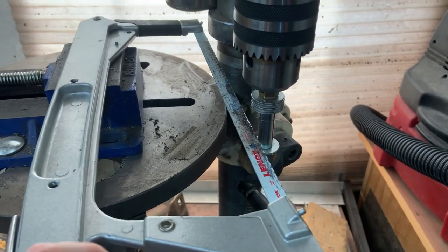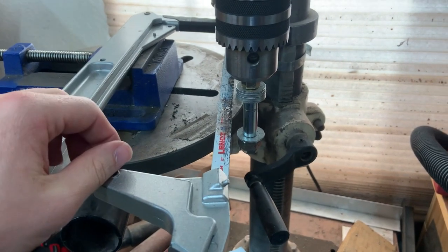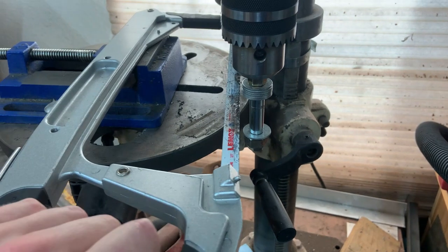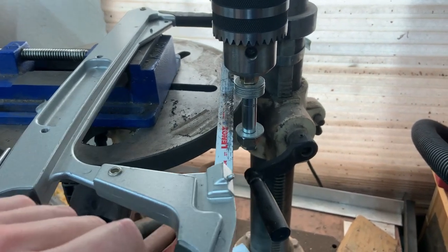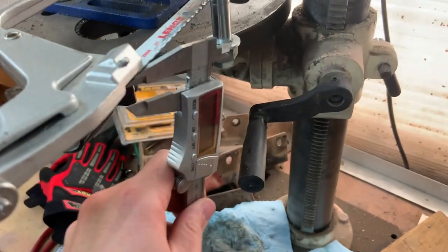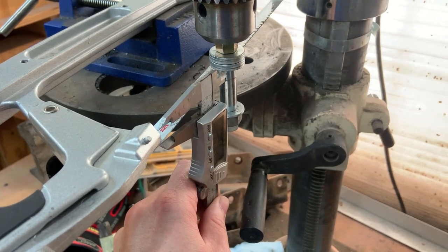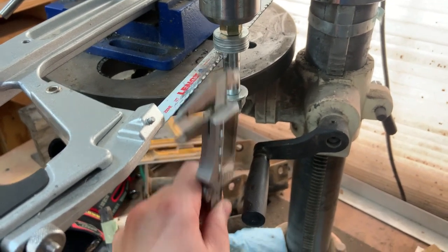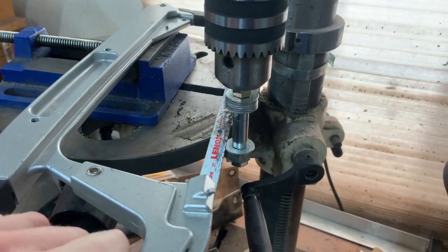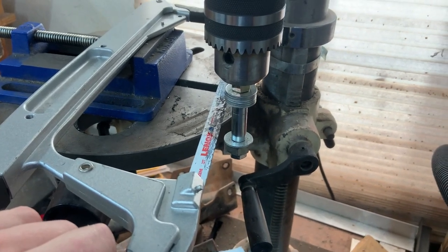So anyways, I've got the drill press on its lowest setting. I'm putting some used transmission fluid on it as a lubricant every now and then. And you just gently, I just made a little score mark with it. Got the micrometer, dial caliper, whatever up in there. Made sure that I was where I wanted to be. And then I just slowly start cutting away at it. Takes forever, but it is making a pretty good cut.